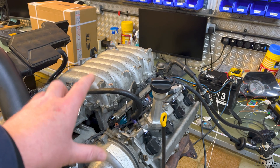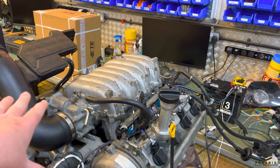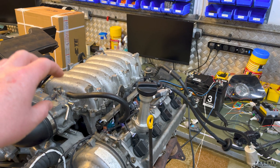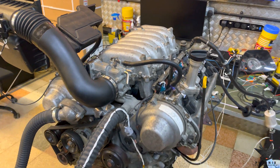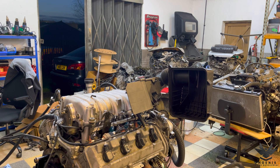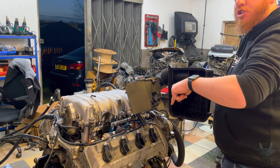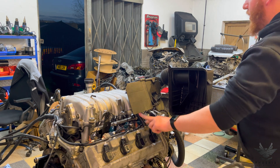What I'm going to do now is put the camera up on a stand so you can see it nicely, turn the car on, start it with everything connected, then lift the pipe up and let it go to atmosphere. You're actually going to start to hear a random misfire for no reason, and you'll also hear it running a little bit differently. Then I'm going to put the pipe back on again and you're going to see that it is running absolutely perfectly. Bear with me a minute — let's do that now. What we're going to do is put the ignition on, start the engine up, remove this pipe, and listen to how the engine changes notes. Hopefully, fingers crossed, it'll actually have a random misfire every now and again.